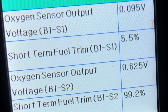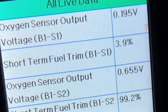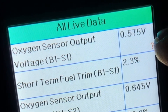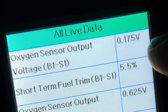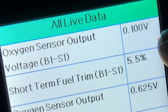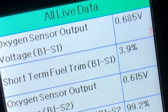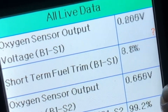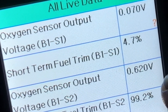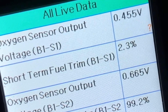So if you're getting a code P0420, check your oxygen sensors, because this one here — Bank One Sensor One — it's all over the place, from .07 to .730 or whatever. I'm pretty sure that's your problem. Right here we're at .65, and it's staying kind of around the same area, so that's pointing to that problem.